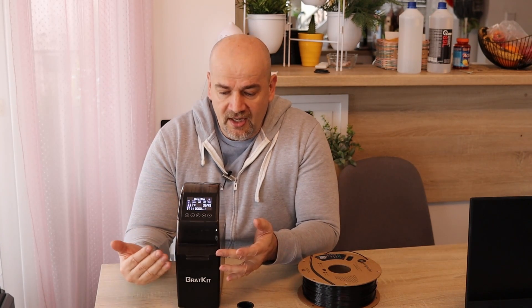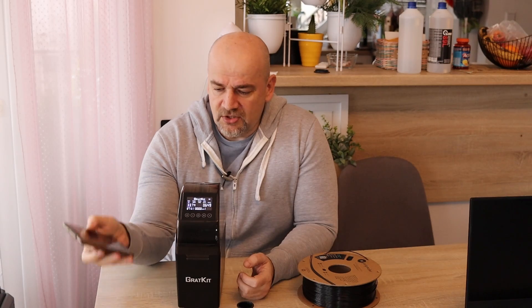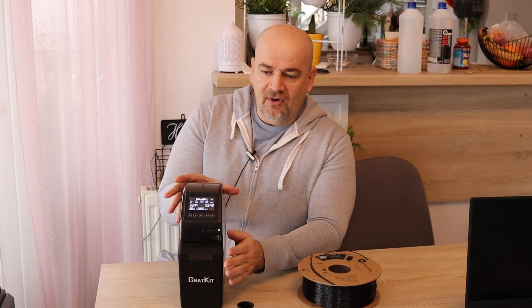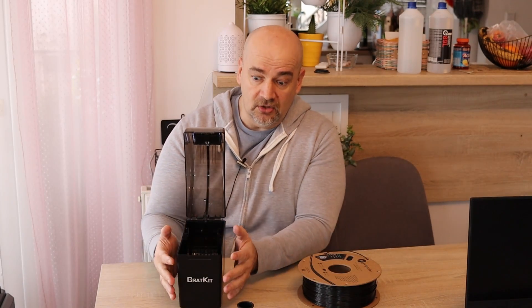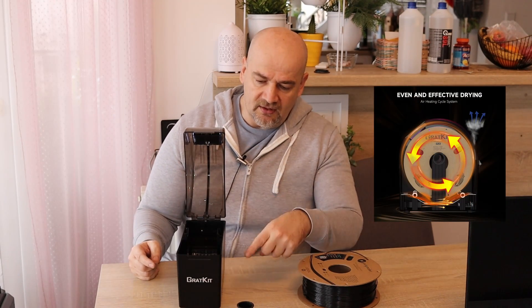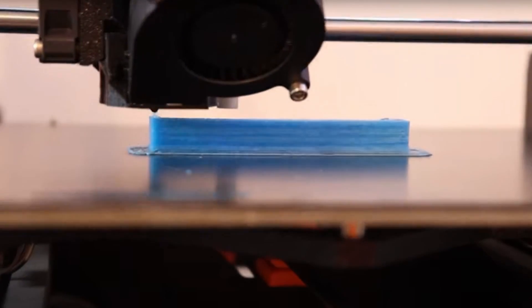But it still has a lot of space for improvements. The user interface is awful. We can always set the temperature and drying time manually, or use the application which works great now, but 300MB for the application is too much. I'm missing a dedicated space for silica gel desiccant. Two or three years ago I tested similar filament dryers that had insulation on the bottom part, but somehow over the years it disappeared — adding thermal insulation on the bottom would result in even higher temperatures or save energy. The drying is also not completely equal — from the bottom it is noticeably stronger compared to the top, so you should rotate your spool manually every hour for more equal drying and to avoid lines in your printing.